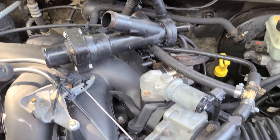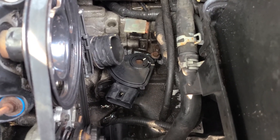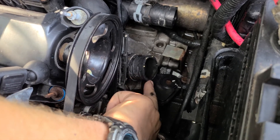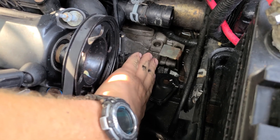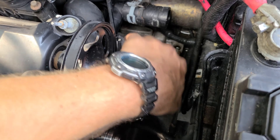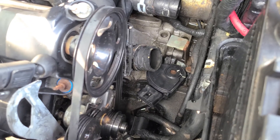We've got the thermostat housing removed — I'll post a link in the description on how to remove that because I've already done a video on it. Now you can see the range sensor, and you can definitely see why this thing would go bad when you're changing that housing — it just gets drenched in coolant. Even though I drained all the coolant out from the drain port on the radiator, there was still a bunch in here. The only way to get it out is to blow it out with compressed air so it shoots out of this hose. I would recommend wrapping a rag around your compressor nozzle and blowing air in here, otherwise you'll be constantly dribbling coolant onto the range sensor the whole time you're doing this job.